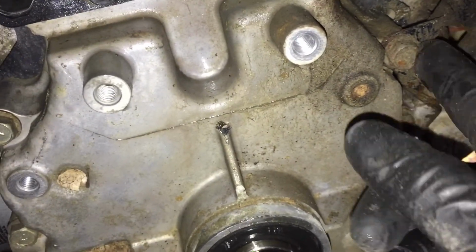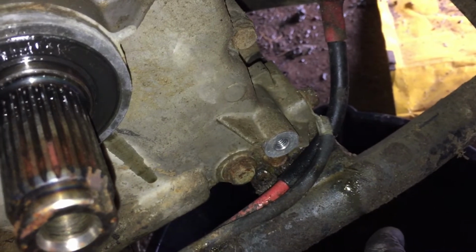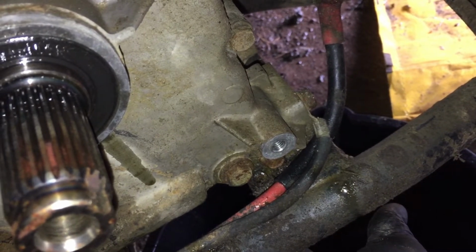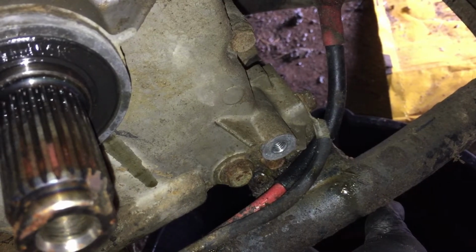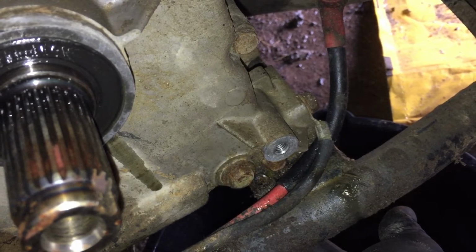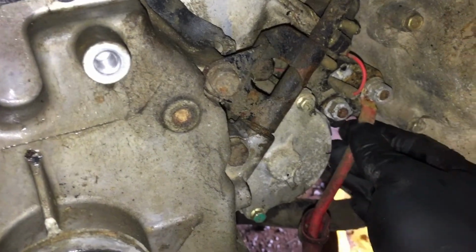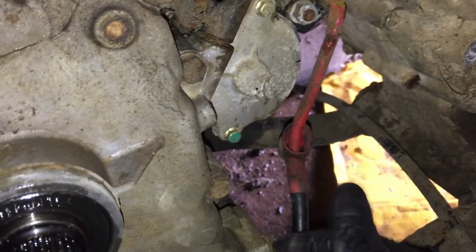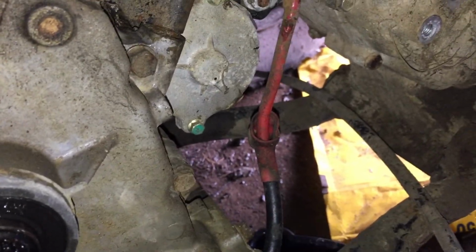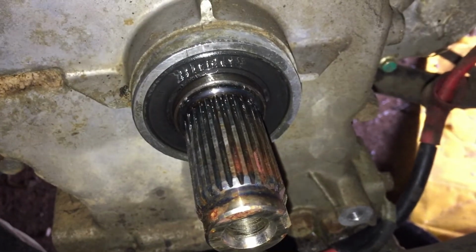We've got to pull these bolts out. We got to also pull the bottom motor mount bolts off, and then I'm trying to think, we might loosen the other two motor mount bolts as well. This thing looks like it's had a starter put on it too, but we're gonna have to take this battery cable off, get this one out of the way, probably cut this tie wrap right here, and give ourselves some room here because we're going to be pulling this cover straight off. So I'll set up time lapse and we'll get busy on this.